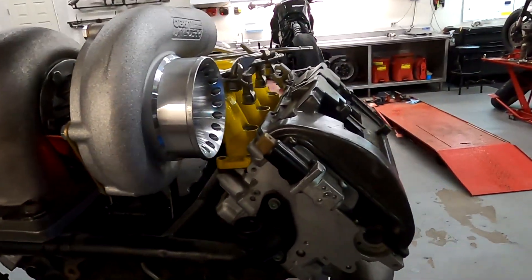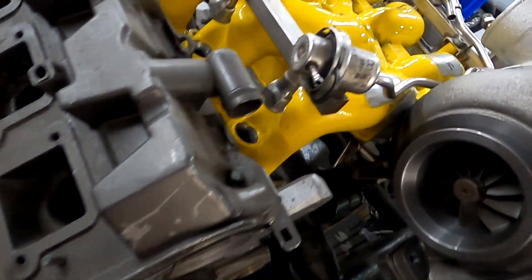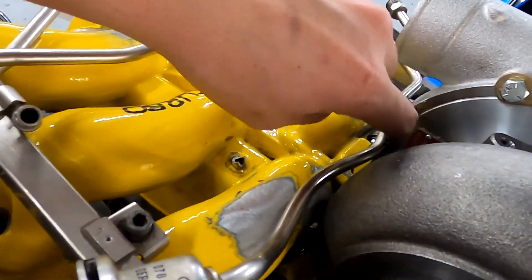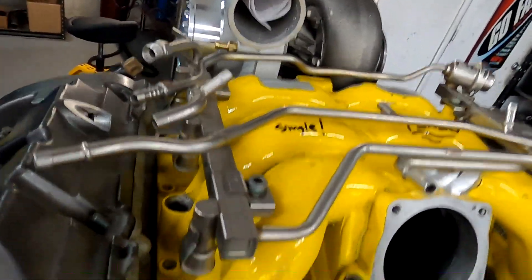The turbo brace is on the new motor. I'm just putting a couple nuts on this header that I had to steal earlier, but it fits identical to where it did before — I marked it with Sharpie on the inside. The fuel rail is on there for fitment purposes. He's not going to keep this rail for very long, and I had to bend it so it doesn't hit the hot or cold side — that's a little close. You wouldn't want that long term because fuel being hot is not good. But it fits perfect and I'm happy I made that.